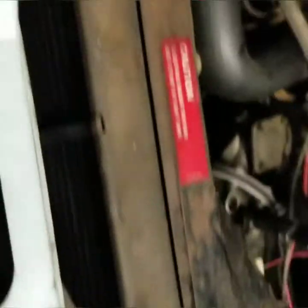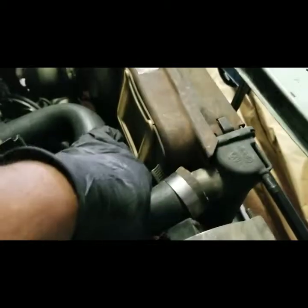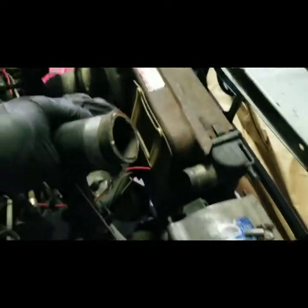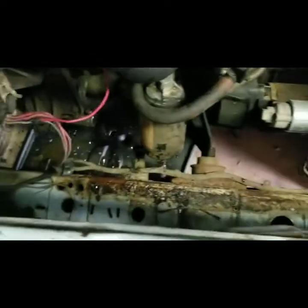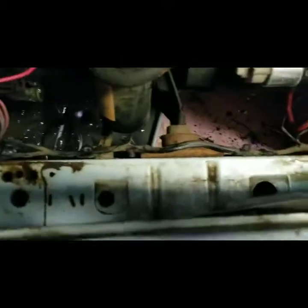This radiator comes out very simply — it's held in by this. We get off this bottom hose and then we get off this top hose. I'm just going to yank it out. If you want to clean up this place where it was, get some of this rust and filth off — it just makes it easier when it goes back in. That looks nicer already.